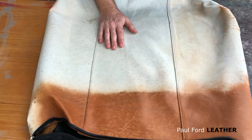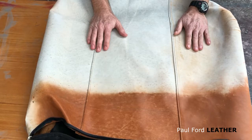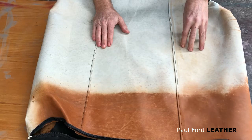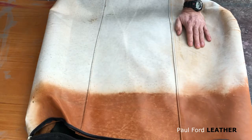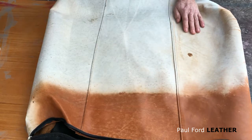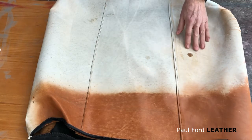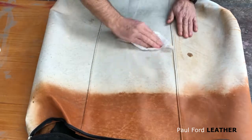The goal for prepping this type of leather is we ultimately want really good adhesion for our new finish, and to do that you really need to make sure the leather is very porous. If I dip my finger in water and put a blob on here — which I prepped about an hour ago — and a blob on here which I haven't prepped, you can see that virtually straight away the water is sucked into the leather and you can see a dark patch, whereas here, virtually nothing. So I'll wipe that away now.